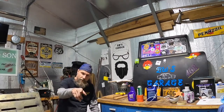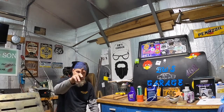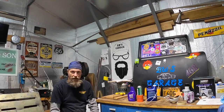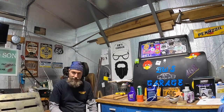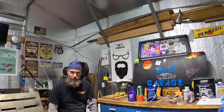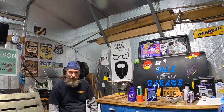And I think the next thing we wanna do is get in there and scratch up, sand up our door jambs. I gotta bring those garnish moldings out. We gotta sand them down a little bit. Larry was nice enough to sandblast them before he brought them, but I still wanna go over them with some 400 grit and check them all out, make sure everything's gonna be cool with them. So we're just gonna keep rolling right along together until we get where we need to be.